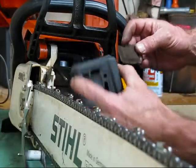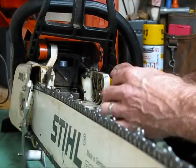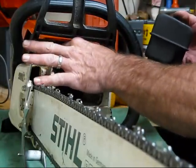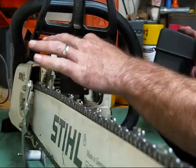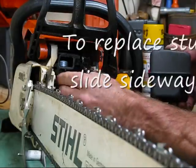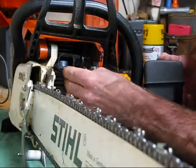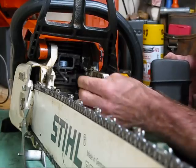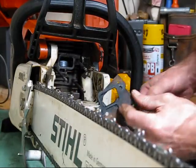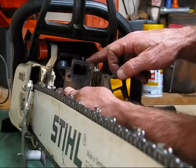The easiest way to put this back together is off the saw. Stick that on there, bam. I was going to show you this — if you happen to bust an exhaust stud, this is how easy it is to replace one. They just slide right out of a little square slot in the side. So snap them right off, don't even worry about it. Make sure you've got your gaskets back on there in the proper order, facing the right way.